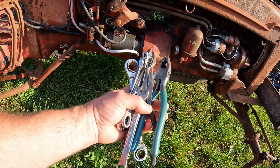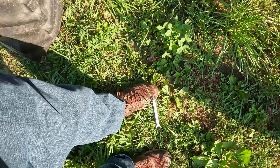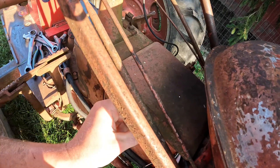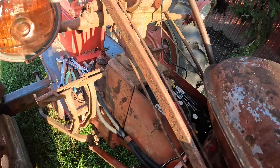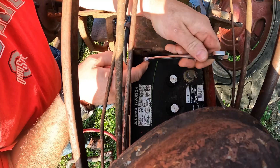Here's one of the awesome things about old tractors — these are all the tools I'll need to get started on this job: pliers, wrenches, you got it, including the one I dropped. The first thing I've got to do is take the old battery out. These are a little bit tricky on the Super C's and Super A's because of the hydraulic controls. This tractor's got a multi-piece battery box, so I just need to pull this one side off here to get the battery out.